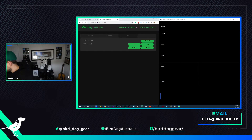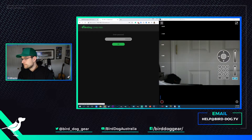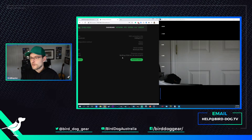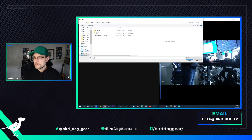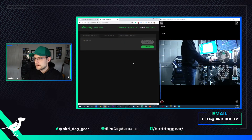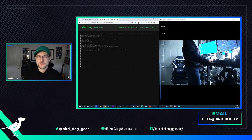I'm going to disconnect the USB now. The camera has come back. I'll type in my password. Studio Monitor now sees the camera on the network — it still shows the old firmware version. So now I'm going to go to System > System Update > Choose File, go to my desktop, and here I've dumped it — it's called no-sync. Open that and Update. That is going to give us the brand new no-sync firmware that will hopefully fix our problems while we sort out what's happening on the previous firmware.